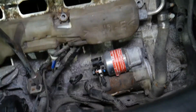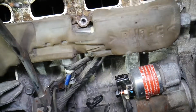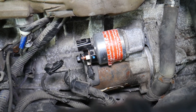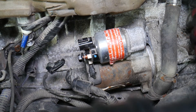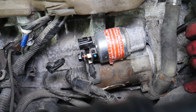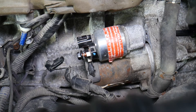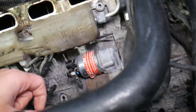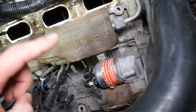Number five: if your Hyundai Santa Fe is equipped with an immobilizer, that can also cause a no-start condition. The computer can forget the key — it's electronics, and it happens. If the immobilizer doesn't recognize the key, your car may not start.